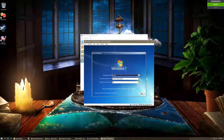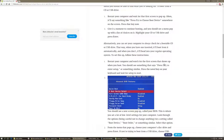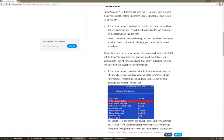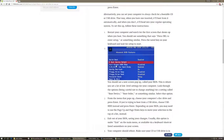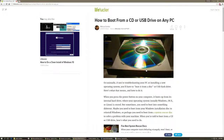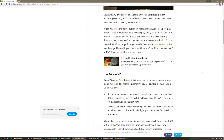But here's another thing I wanted to show you guys. Here's another link that I'm going to put in the description. This will show you how to put whatever medium you installed the operating system with up at number one on the boot list. See, this is a boot list, right? You basically want the device to be at the top of the list, so that it's the first bootable device. Whatever OS you're going to install needs to be first. This guide will pretty much show you how to do that, hopefully. If not, there's other guides on YouTube that you guys could find. This is just one that I think will be good for that.